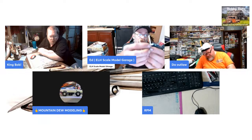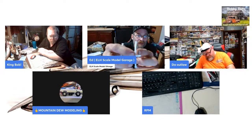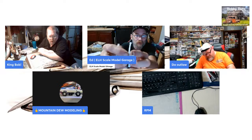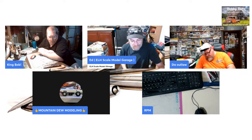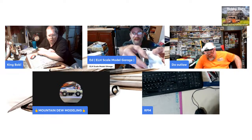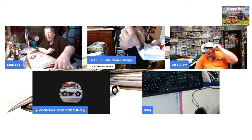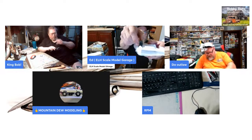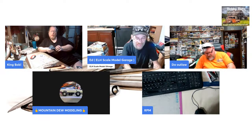And you can't just do an axle flip kit where you put it on top of the springs? Uh-uh. Also, I'm going to have to cut this part of the axle right here, in between where the wheel attaches and the spring, and then shorten the axle, because the axle is so long end to end that it'll keep the wheels sitting outside. So you've got to do a whole narrowed rear end and lower. Yeah, it causes the wheels to sit outside of the body panel like that, and I want the wheels down in the body panel. I don't want to modify the body at all to do this kit.